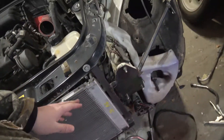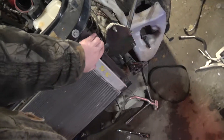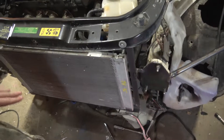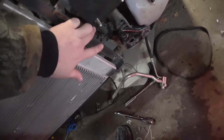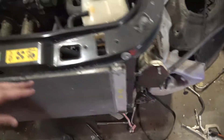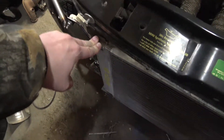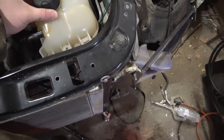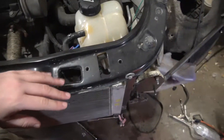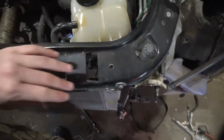I need to finish up the rest of the cooling system. I need a little more support because the radiator mount is kind of shaky even when bolted up. My plan is to weld in an extra support on both sides. There's a bolt point where I used a rivnut — it actually holds the radiator pretty steady. I also need to figure out how to mount the coolant tank. I think I've got a solution to tee off of this fitting.